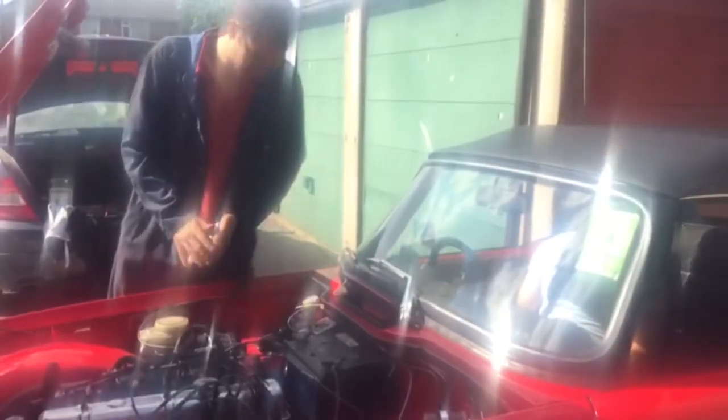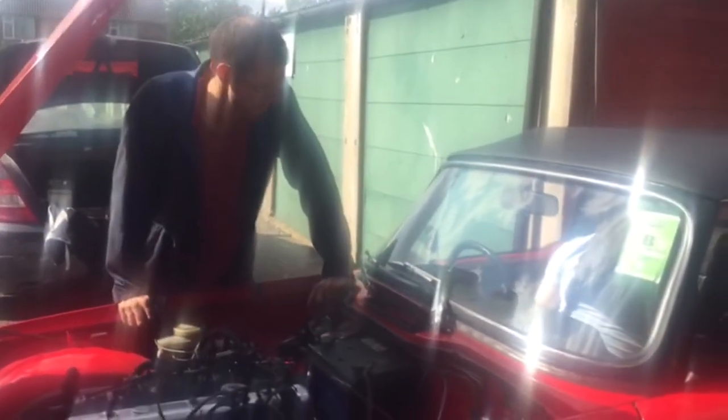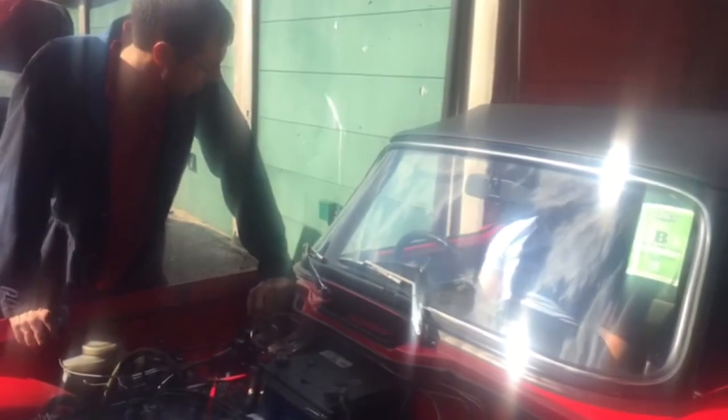Okay. Right, well, we've topped it up with oil. Put this oil pump in. We've checked the rocker shaft, as we said. And now's the job to start it up and see whether it's worked. So, Dan, if you want to pull out the choke, fire her up.